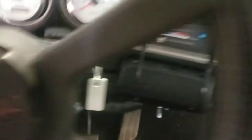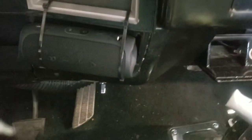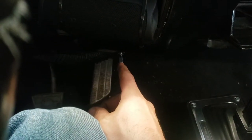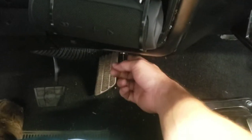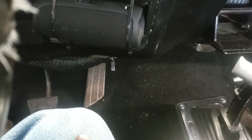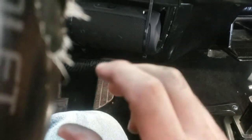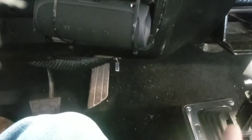After driving this for a while I became very annoyed with having to reach way up under my dash to get to a switch down here. You can see this switch that I currently have — I have that actually wired into my starter, so the truck will not turn over unless that switch is pulled. It's just a little security thing; kind of cool. Even with the key in the ignition, if that switch is not turned on and you turn the key all the way, it won't start.